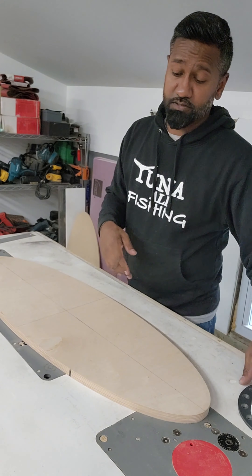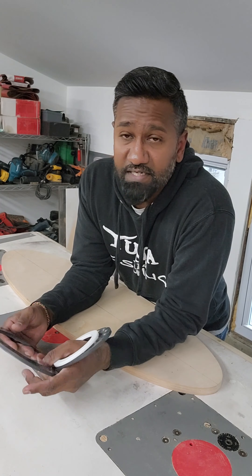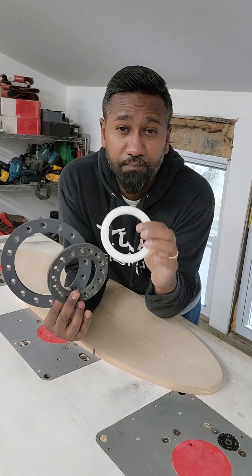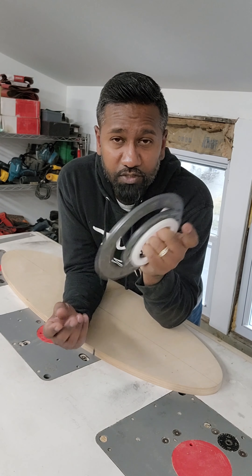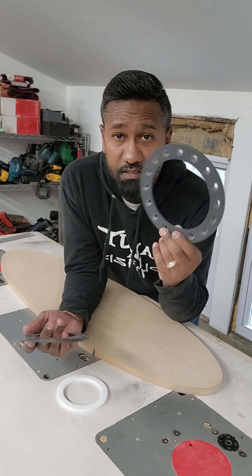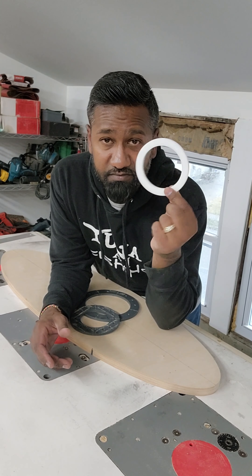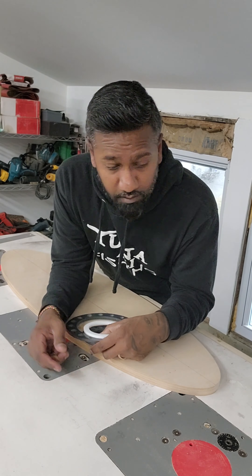What you need to do is find out the outside diameter and the cutout diameter of your speakers. I've got three different sizes of templates here for various speakers — makes life a hell of a lot easier, especially when you only deal with certain brands. Stick it on there, router it out, you're good to go. Let's make believe this is an eight, this is a six-and-a-half, and this is a super tweeter — we're going to lay out a couple of each.